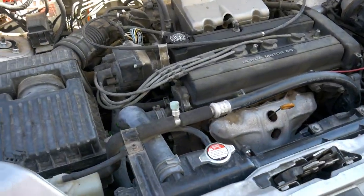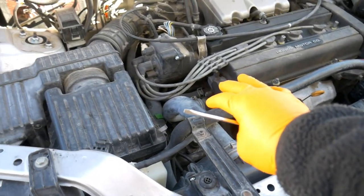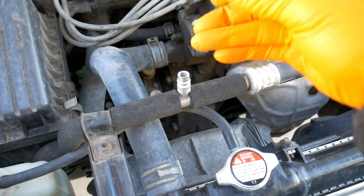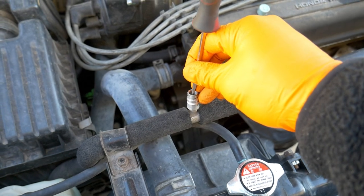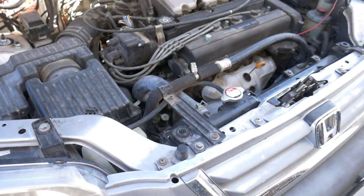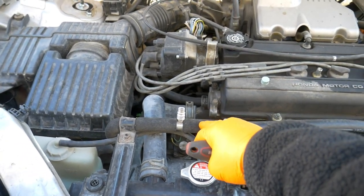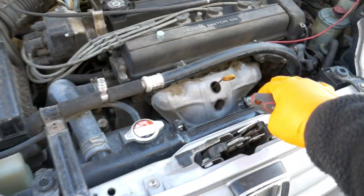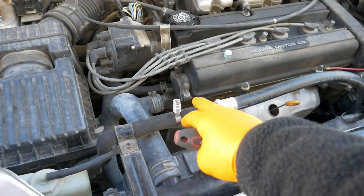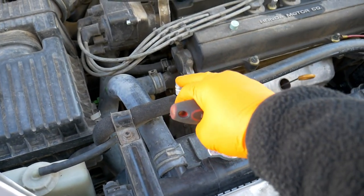If you're attempting to do this on your own, you do need to remove the remaining R134A — or Freon, or refrigerant, whatever you want to call it — from the system. If you're unsure whether it's still charged, an easy way to find out is to remove the low pressure cap, get a screwdriver, and just push the Schrader valve down quickly. That lets you know right there if your system is still fully charged. I have it scheduled to be removed — I'm taking it to a shop. R134A, even though it's non-toxic, is a greenhouse gas, so I'm going to have it pulled professionally.